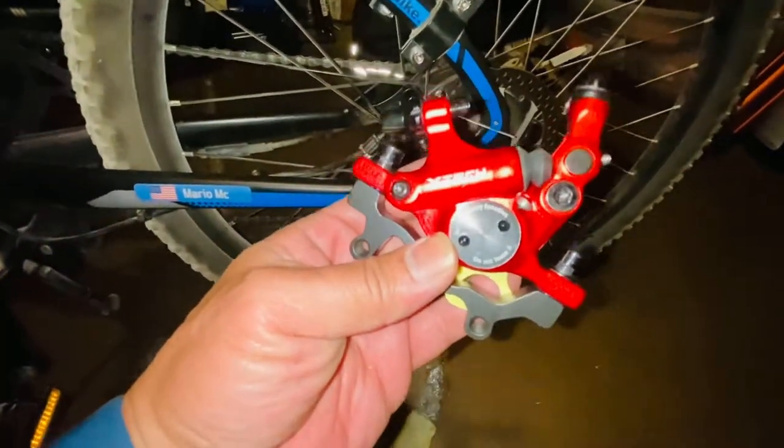I'm going to show you how to install this. I already installed it on my bike so I know how it performs — hydraulic brakes are way better, the bike stops much quicker. Your wheels tend to be quieter too, because the brakes don't scrape on your disc. With mechanical brakes, especially if your disc is warped a little bit, you can hear scraping. Hydraulic tends to be much quieter.